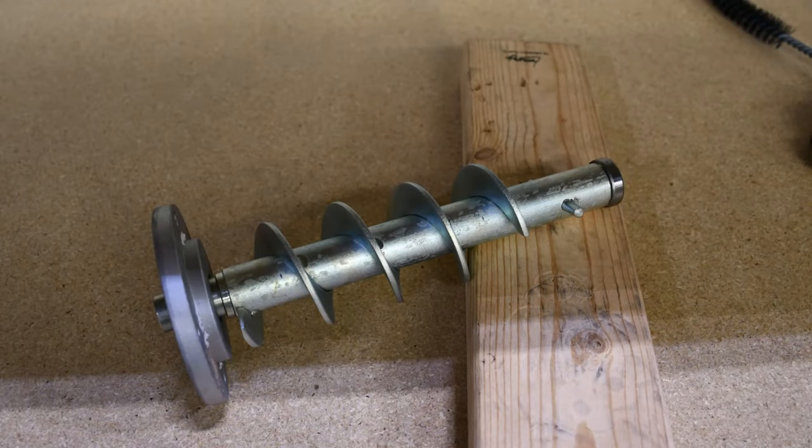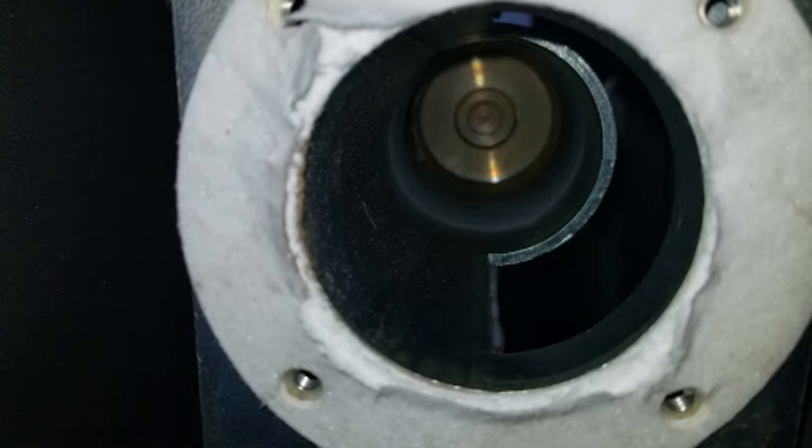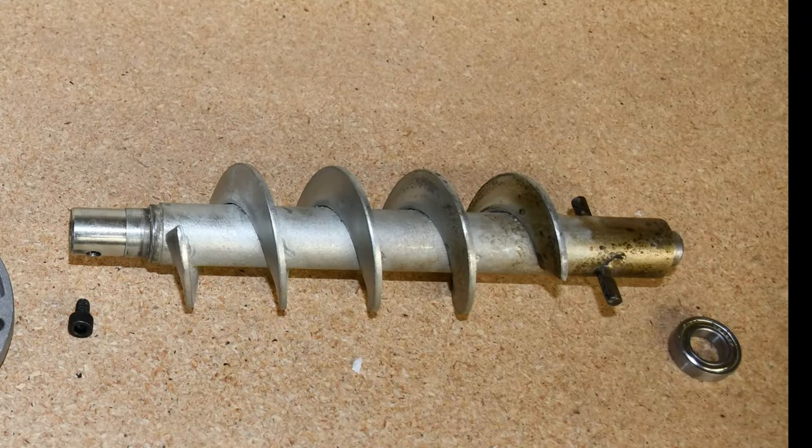You will want to inspect the housing, both the upper and bottom bearings, as well as the auger bit to ensure nothing was damaged. The housing should be relatively clean, and the bearings should roll or glide smoothly without catching. Make sure that the flighting around the bit is welded and intact.